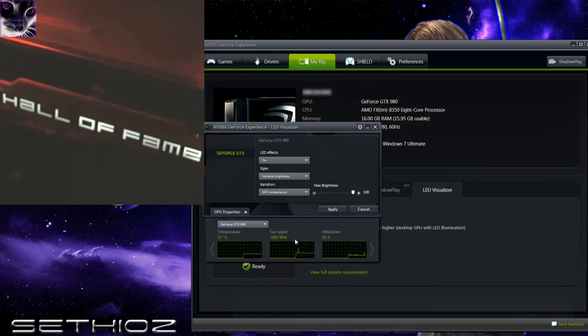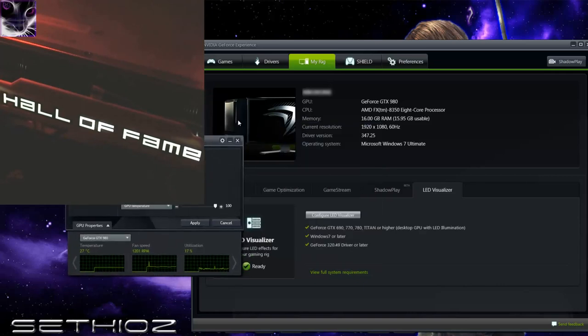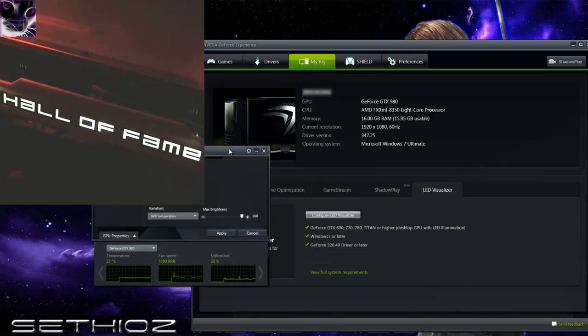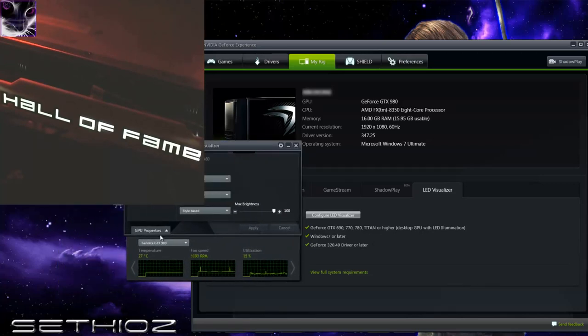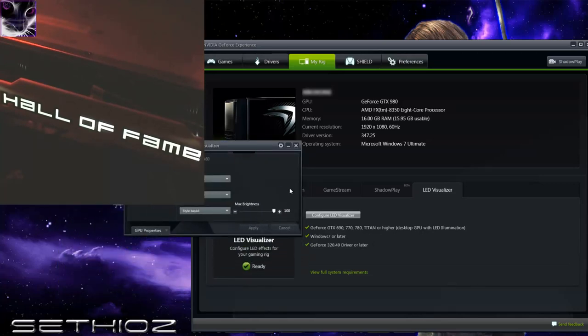And that mysterious switch on the back, it actually is fans. It turns the fans on absolute maximum. It's called the overclocking switch. I'm not entirely sure if it changes the clock speeds, maybe it does, maybe it doesn't. But I have to check it out, because I don't think it actually changes anything. It just changes the fan speeds to maximum. So if you have any heating issues, then that's the option. I clicked cancel. Okay, it's just canceled to default.